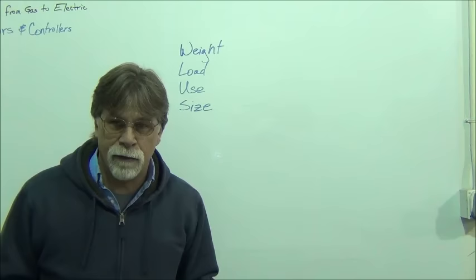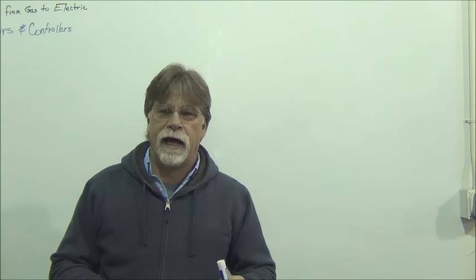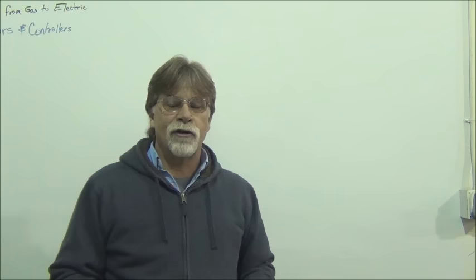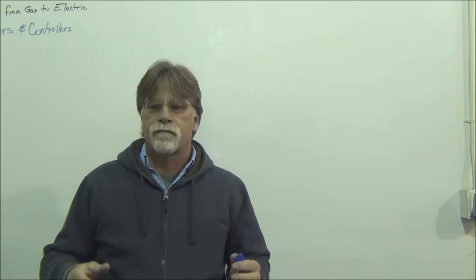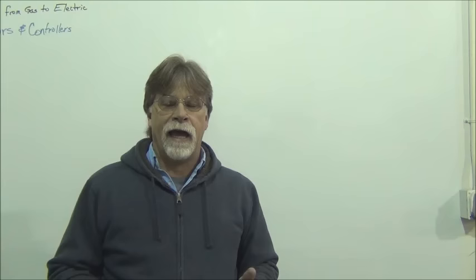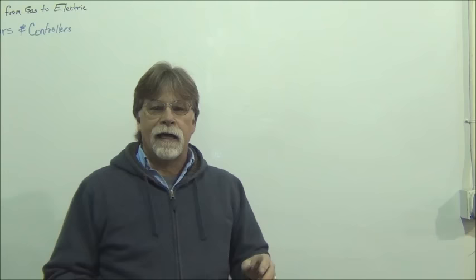Now let's talk about controllers. Again, there's going to be some different types. In general, we're going to have DC controllers and AC inverters, which are also typically called controllers, even though technically it's an inverter, but they call them controllers because it's what's controlling the motor. Now, the DC ones were less selective. In other words, you could have an AMD manufactured DC motor, you could have a NetGain manufactured DC motor, and those could use any DC controller.